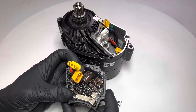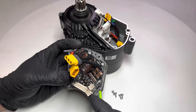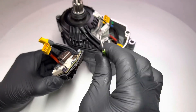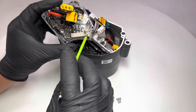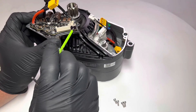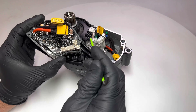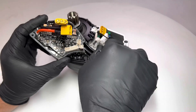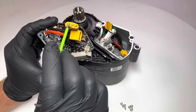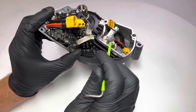Alright, here we have the Luna V2 Ludacris controller. All the connectors are going to have dielectric grease in them and you'll have a gasket pre-installed — be sure your old gasket is fully removed. We're including four mounting bolts with a socket-style head, making them much easier to install. There are two identical-looking connectors: the temp sensor has black wires so we blacked out that connector. Your torque sensor plug goes into one port, and your temp sensor into the other. You have your big main com connector, three keyed phase wires, and your main discharge wire which is an XT60 — neither the phase wires nor the XT60 will let you plug them in backwards.